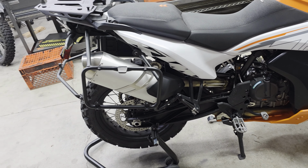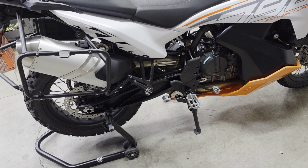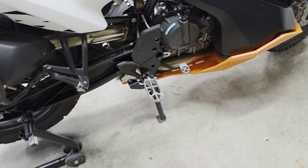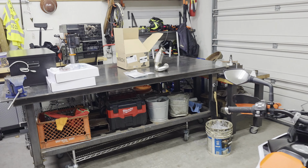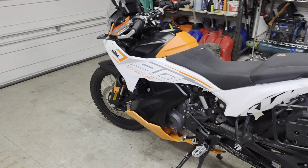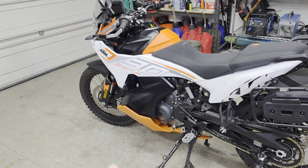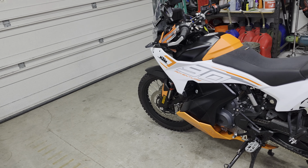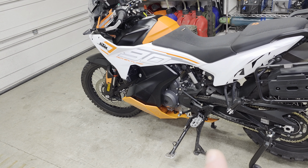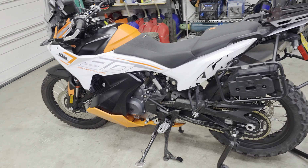We're going to basically disassemble the whole bike and get that suitcase or black box or whatever you guys want to call it out of there, and we're going to install the aero mid pipe. Now, I have a feeling from work that I've done on vehicles before that I'm going to lose low end torque because of the high flow mid pipe that's going in there. Now, that may or may not be true because I'm going to be using the original exhaust.